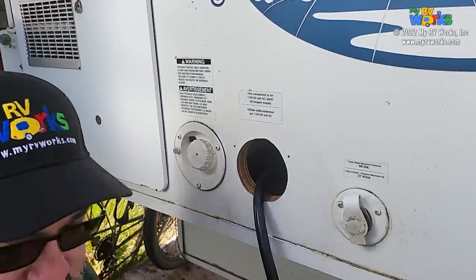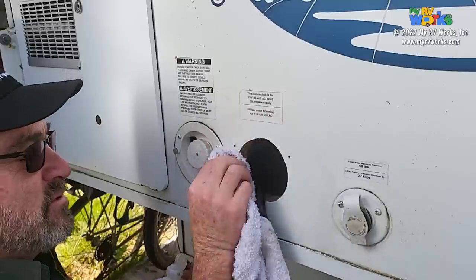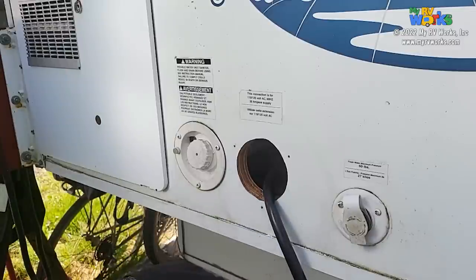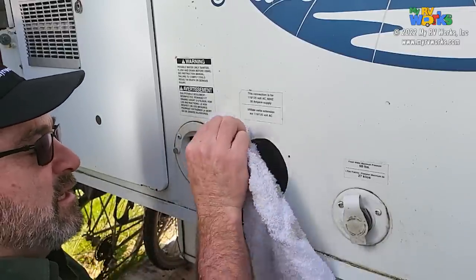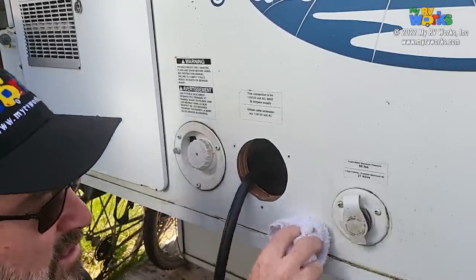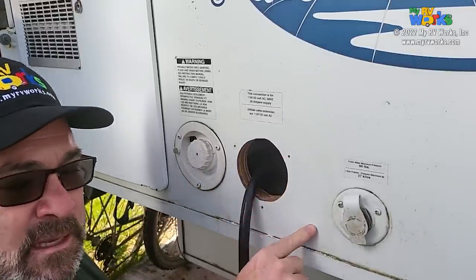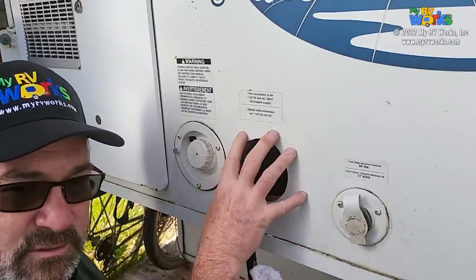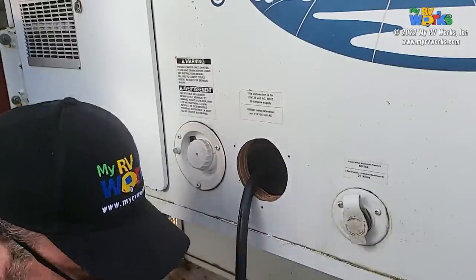Now, another thing, whenever I use that adhesive cleaner, I always hit it with some alcohol. There's those little sticky back things you get for all kinds of stuff, and they always come with a little alcohol prep pad, and that cleans everything really well. So my thinking is, let's just clean everything real well. And it's got that noise going on to it, so I know that it's clean. Whereas if I hadn't done this and I just would have kept the adhesive remover on it, it may have had a little bit of a residue. And my thinking is the adhesive remover is what's used to get it off. So if I don't get that residue off and I put butyl tape on it, it might fight me to really stick well.